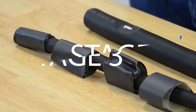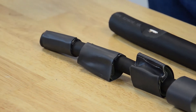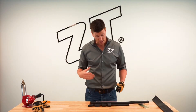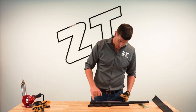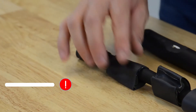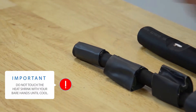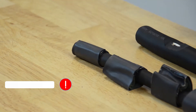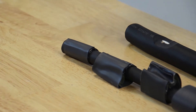Once we reach this stage, stop applying heat. I like to turn the heat gun off and just blow cool air across the seam to let it fully cool. I'll have one hand out of the glove so I can touch it and make sure it's plenty cool. Once cooled, you can see it's very strong — there's a little adhesive residue but we'll rub that off when the repair is final.